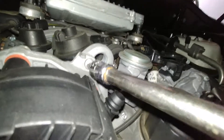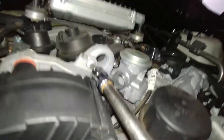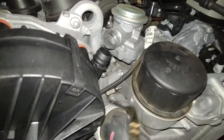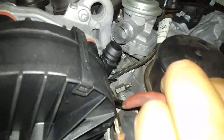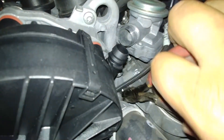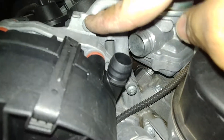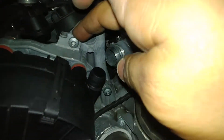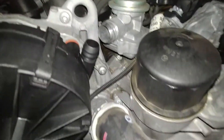I don't know the torque specification so I'm just gonna go with my hand and check back in a few days after it's been running. Just gotta be real careful — be patient and don't try to film and do other things at the same time. Just be real patient, take your time with your bolts; you don't want to strip any of those threads, either in the bolt or where it's going in — that's the last thing you want to do. Get them all aligned, put them in by hand first, and once you know the thread is right, go ahead and get them tightened.